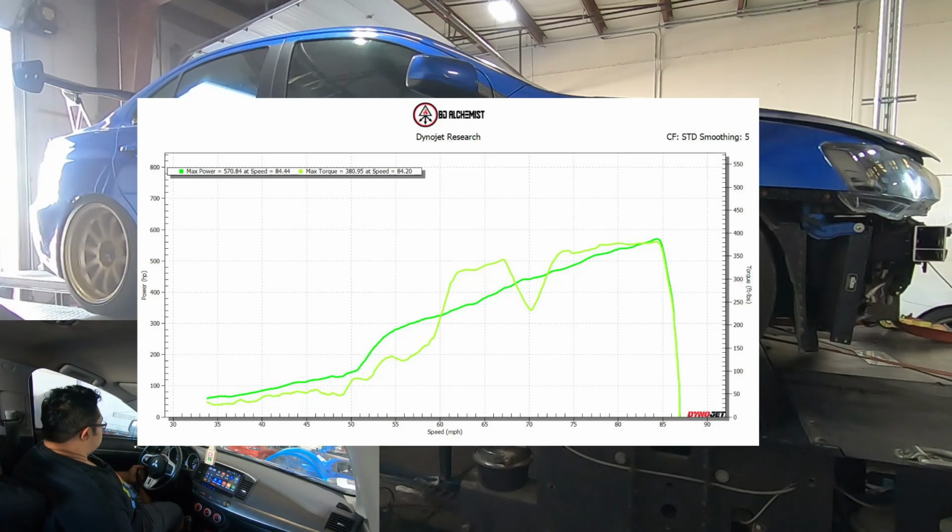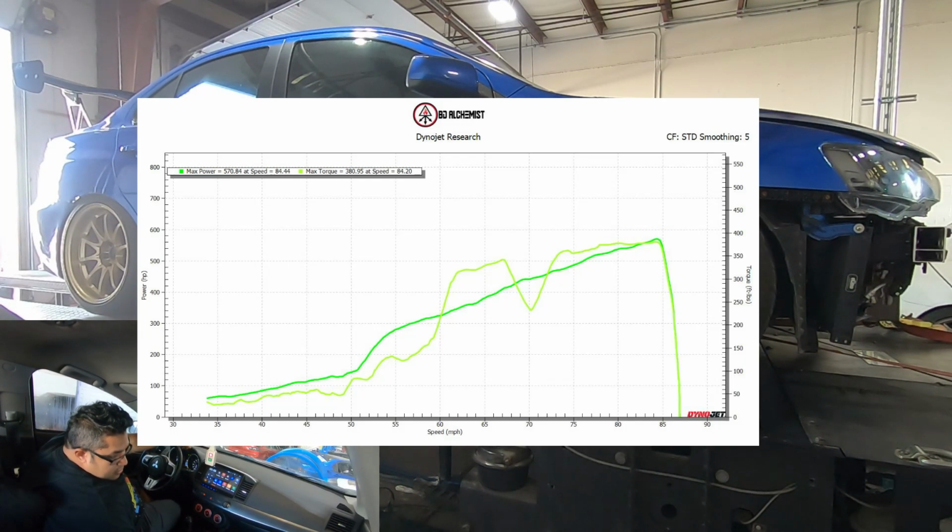So this is with just a fuel change. It was 75% ethanol. No other changes, no boost, no timing, no nothing. And as soon as we changed the fuel, it was like 10.5, maybe 11, low 11s AFR, which is very rich. So I have to adjust the scaler on the flex fuel that the ECU Master strategy is based on.